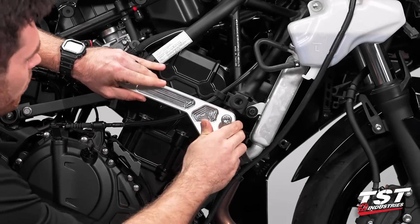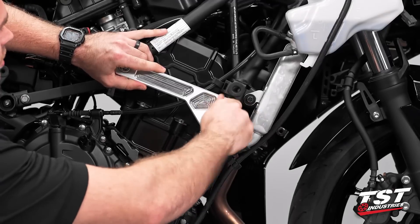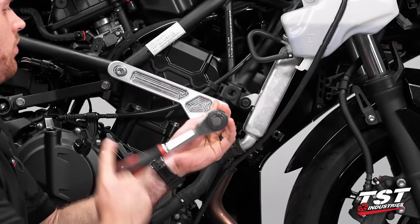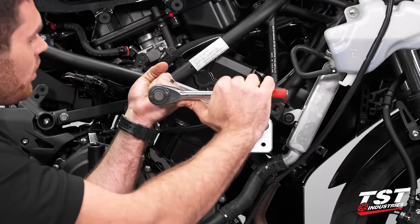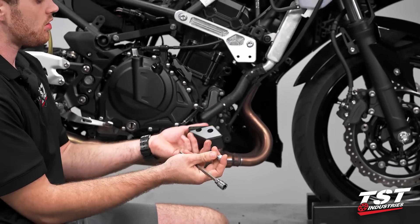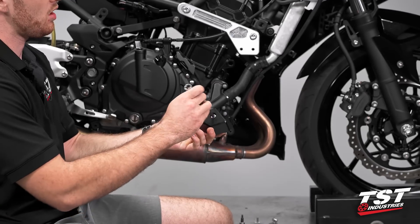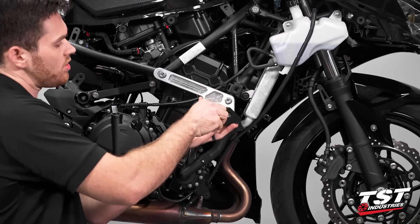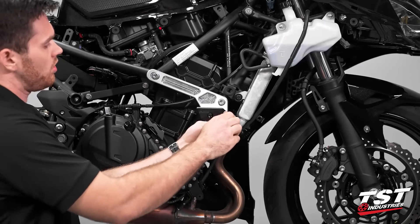We provided some adjustment in the back so you can back off on that fastener just a tiny bit if it's slightly too tight to get into the right position — that gives a little more adjustability. Get the bolt to bottom out and start to hand-thread that back into our engine. Once confident a couple threads are caught by hand, switch back to the tool. With our bracket on, grab the right side Delrin component and the M8 fasteners. Drop them down into the accepting features on the Delrin component, locate them, and use an M6 allen key to hand-thread into the bracket.